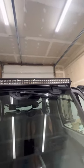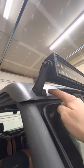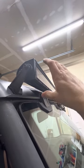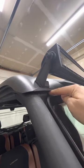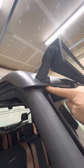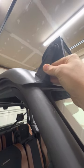Moving up top, this is a 50-inch Black Series light bar from Rough Country. I started by mounting it to the roof, but the weight of the bar was pulling it down and actually rotating the roof slightly forward. So instead I drilled through this plate, ran a bolt through with two 1/8-inch shims and a couple of rubber washers inside to keep it rigid, with nuts and washers on the bolts behind.